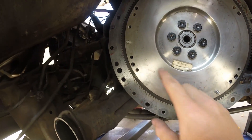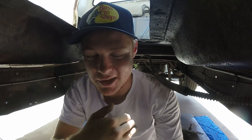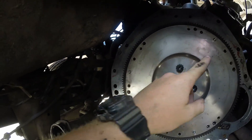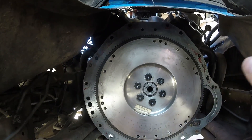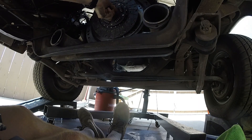I finally figured out what I was missing — these dowel pins that align the clutch. The kind of clutch I have is a six-bolt clutch, and these little pins sit in here to align it. I was originally trying to put this thing on without them and I could not get it to align — I was taking a caliper going around every sixth hole, aligning it by thousandths of an inch, and I just could not get it. I bought this used and had no idea it was a dowel-pin clutch. I went on Summit and got a Ford Racing dowel pin kit for a pressure plate — it fit, I tapped them all in, and now the clutch actually sits on them perfectly.